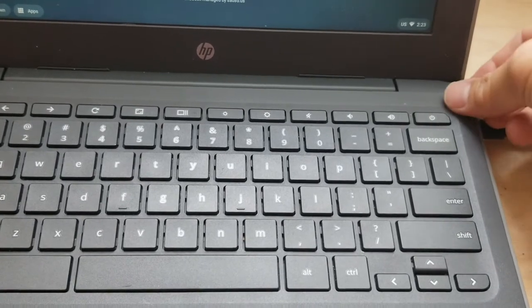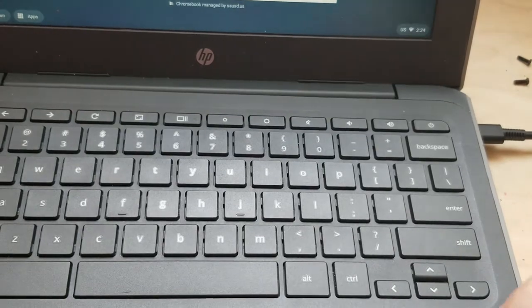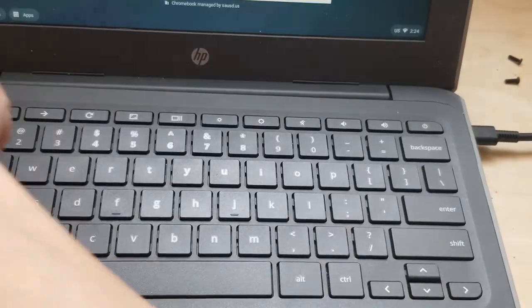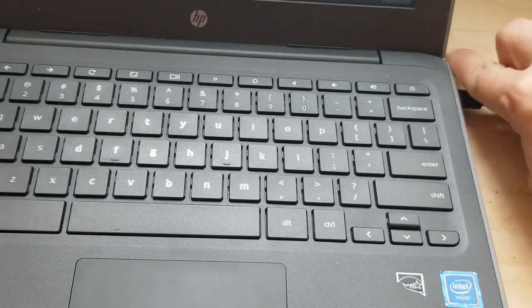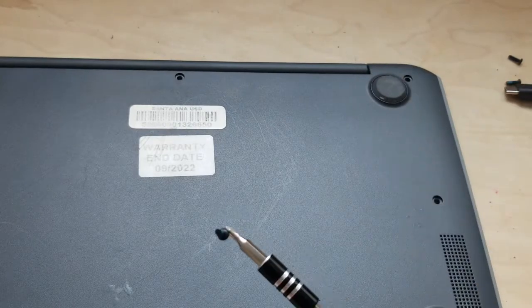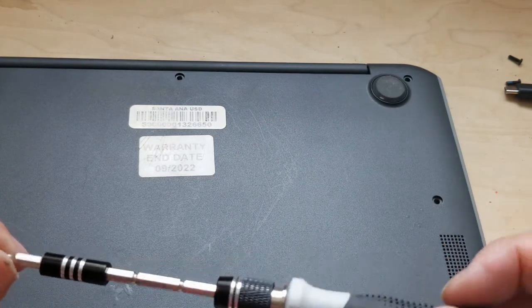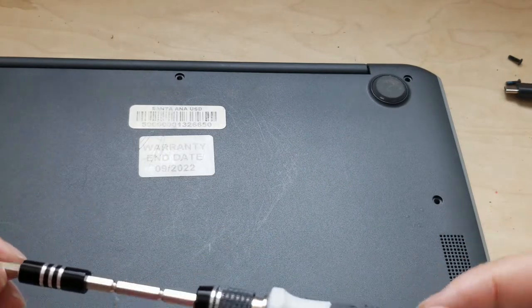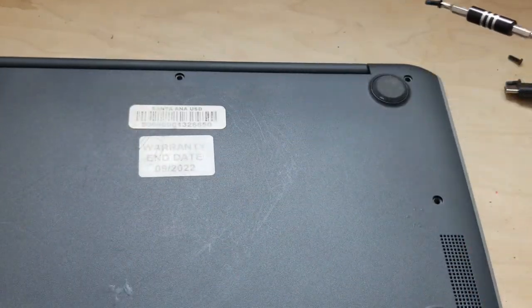Go ahead and snap the keyboard in. Make sure to snap on the edges, not in the middle, or you'll damage the keyboard. Snap it in until you hear it click — that's normal. Do the same along the top and bottom. Once it's snapped in, put the screws back in. Remember, the long screws go on the top — don't put them at the bottom. That concludes today's tutorial. Don't forget to subscribe to my channel. I'll show you many more simple technical tips that may help you work with devices. Thank you for watching — if you found it helpful, give it a thumbs up and hit the notification bell. See you next time!